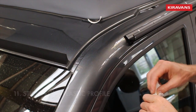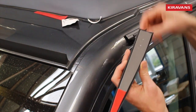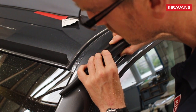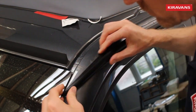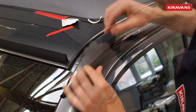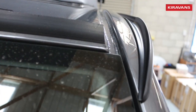So that's your rail in place. Now we're going to stick on the front plastic profile. Again, a bit more degreasing — you can save your alcohol wipe by putting it back in the pack. Take off the backing strip. If you want, you can put a bit more adhesive on the end of the metal rail before you stick this on. Position it so that the end of it is just going to overhang your windscreen pillar and channel any water down beside the screen. Take off the remaining backing strip and press it firmly in place.